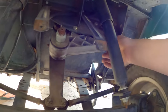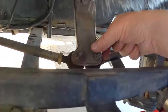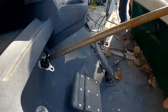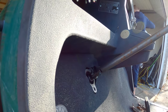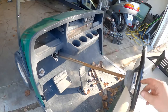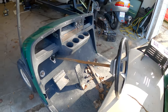We're just going to walk through everything we need to do in order to swap this steering box. This is the steering box right here, attached with a couple bolts. There's also the steering arm right here that needs to come off. There are castle nuts with a cotter pin, so I'll have to pull the cotter pins out. I also need to undo the steering shaft, and I'm going to pull the steering wheel off so I can attach everything first, then put the tube on, then attach the steering wheel.